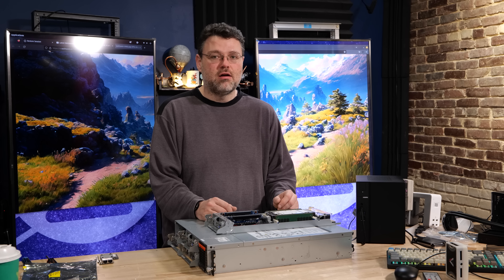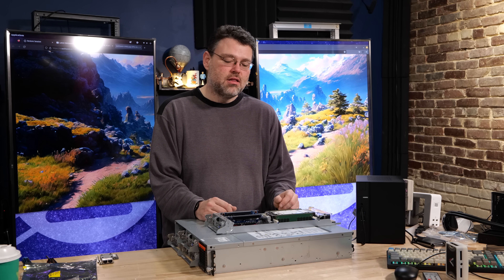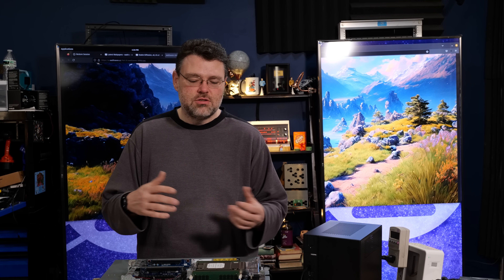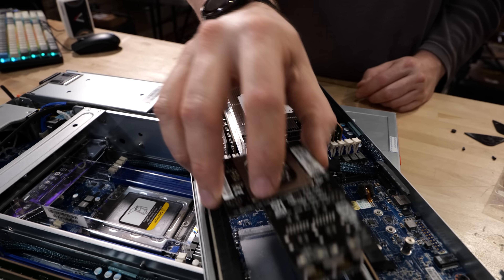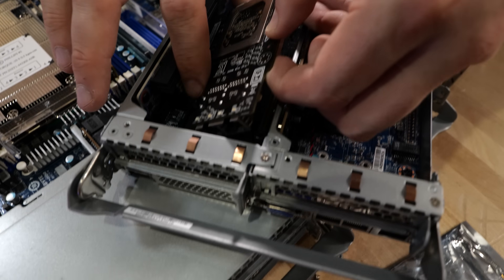It's not going to matter. Dual 25GbE is enough for all but the very latest generation SSD SANs as well. If you are running an SSD SAN or something like that, then maybe InfiniBand makes a little more sense. But everybody's got to start somewhere — you don't necessarily need that. There are still people rocking surprisingly large clusters on dual 10GbE interfaces, even over copper and not fiber.